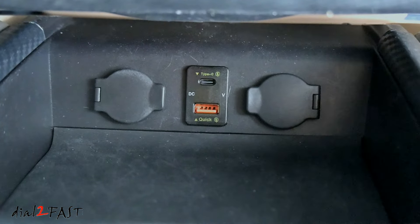To make removal a little easier I'm going to move the shifter to the middle position. There is a shifter release button right below here. If you press that you can move the shifter, but make sure you have your parking brake on when you're doing this. Now underneath here there's one more connector you need to disconnect — that's for illuminating the gear selection. Once you disconnect that, this panel can come out.